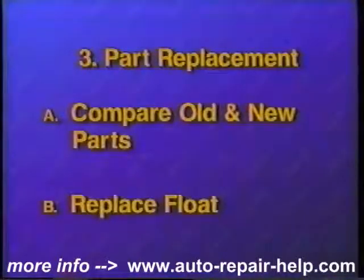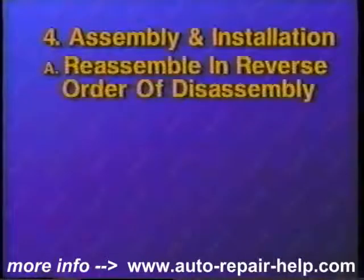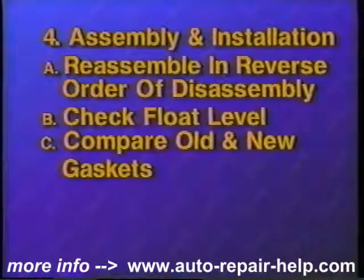Step 4, reassembly and reinstallation. Reassemble in the reverse order of disassembly or by following the steps backwards on the instruction sheet. Using the float gauge supplied, make sure to check the float level adjustment before installing the air horn or float bowl. Also be sure to compare any old gaskets with the new ones to be sure of correct final operation.